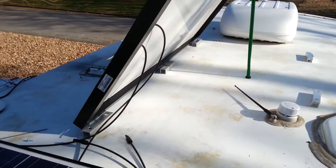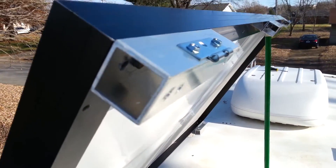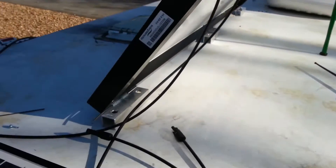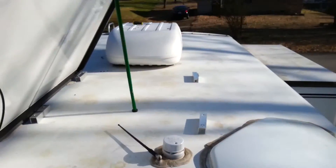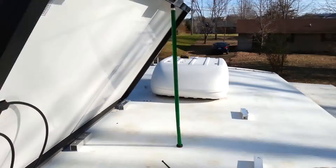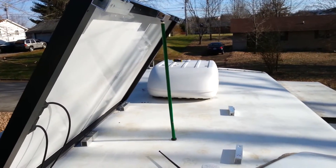I kind of made my own hinges - you can see how they're made here. I just used inch and a half square tubing, put a hinge in there, another piece down here. You can see how they use wagging hinges from either side - see how that side's pivoted up. Eventually I'll make some brackets that'll run from here to here, so I can quickly fasten on there and keep them at a 45 degree angle or whatever I need.